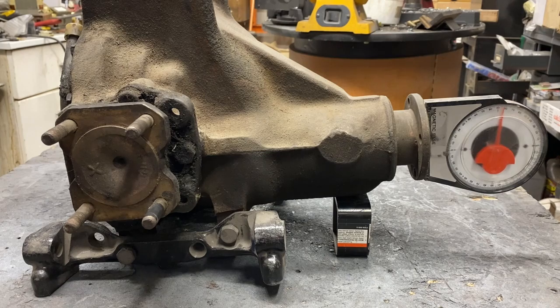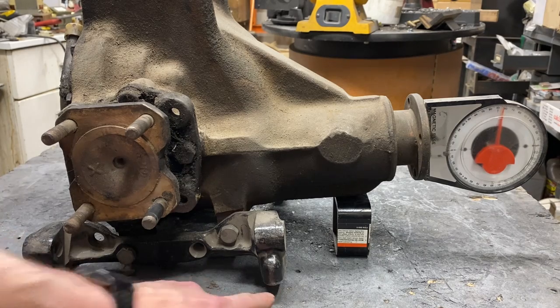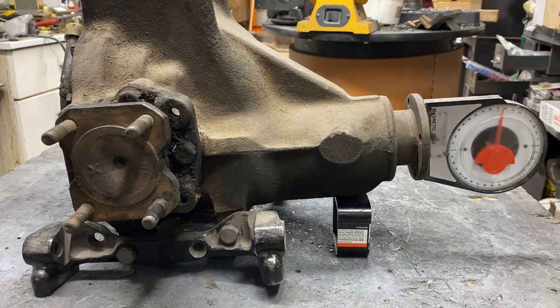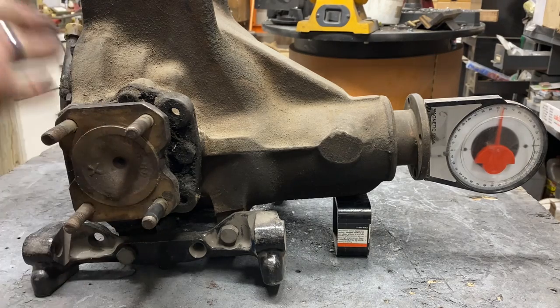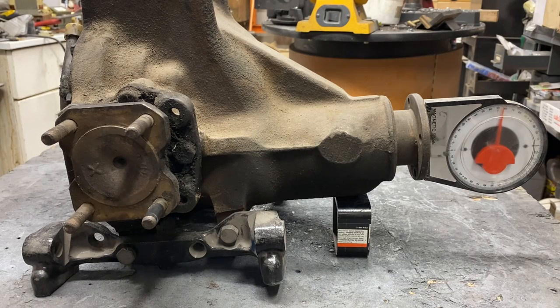As soon as that stops moving, it's going to be right around five degrees — the typical down angle of a transmission. But now we are no longer parallel with the road. There's almost a half an inch of difference between this point and this point in relationship to the surface. So that means with this tilted up, as the suspension is going through its travel, it's going to be traveling backwards. At five degrees, that's probably not a huge change, but it is going to shorten and lengthen your wheelbase.